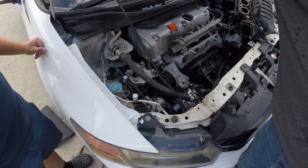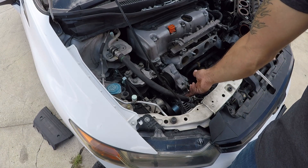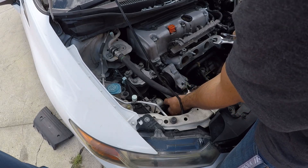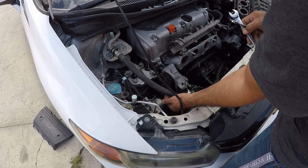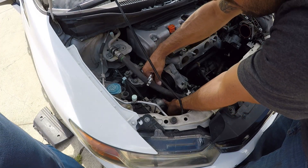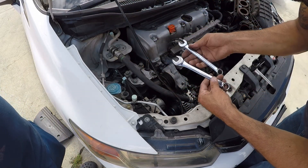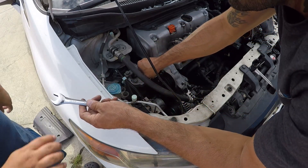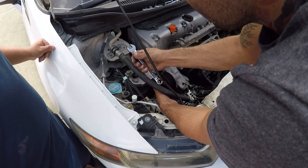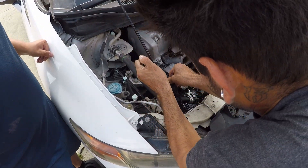Once you've got your three bolts — two are the same, one is different. The different one is the top bolt, which is a long bolt, and then two smaller bolts go on the bottom. Now to route the belt, you need to adjust your tensioner — however your belt routes, find it and get your 14 millimeter wrench or belt tensioner tool to hold it.